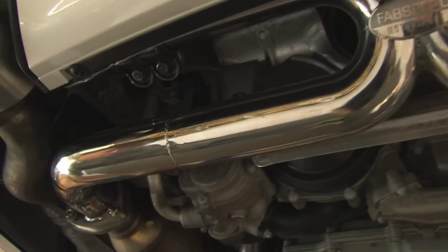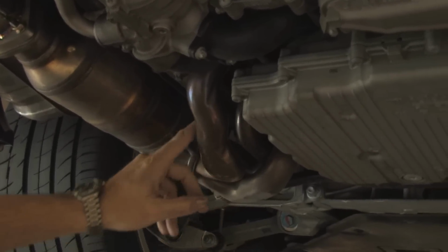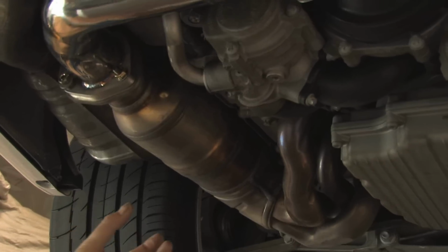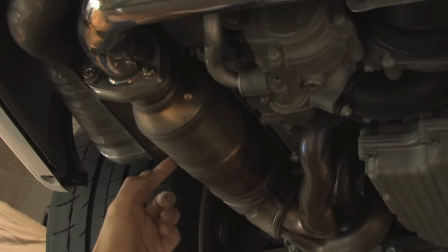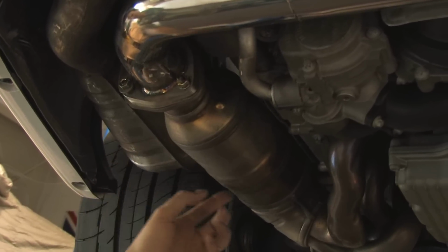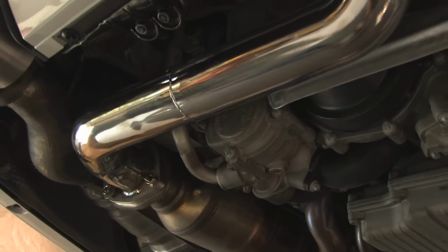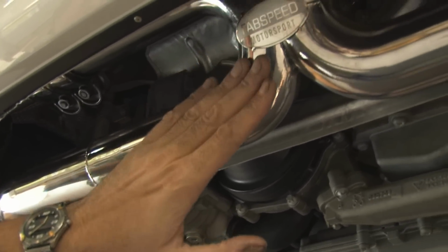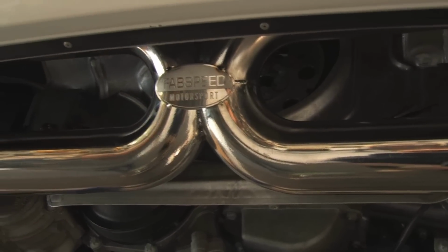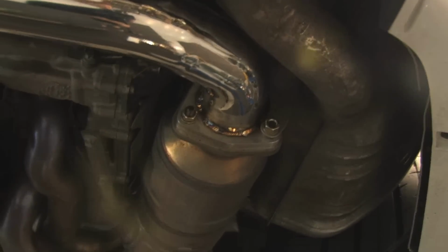And this is a teaser here, the hydroformed stainless steel headers with all the dimples so a mechanic can get sockets on them. And then there's four catalytic converters on this car. 2 in the front, O2 sensor in the middle, and 2 in the back. So there's about a 10-inch long catalytic converter setup, but that's what Porsche engineered. Anyway, headers fire through the center muffler. We're replacing it with a tuned high-performance X-pipe. And then it goes through these factory side mufflers that are sitting under the haunches and the tips.